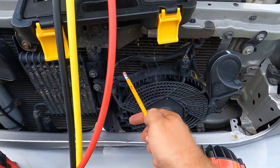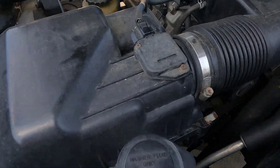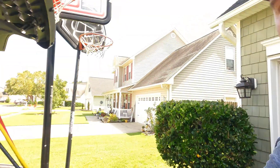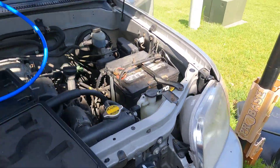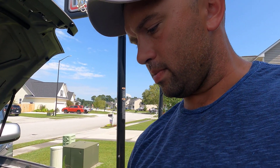Now, does the issue lie at the relay, or does it lie at the sensor — which I think is this? If it's a sensor issue, I'm going to have to drain the whole system. Cheap way to start is to change the relay — relays are cheap. But I don't believe I'm getting full electric fan operation.